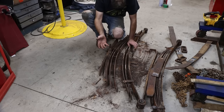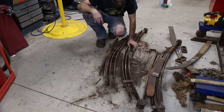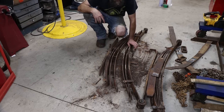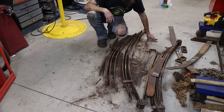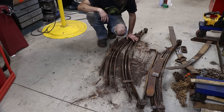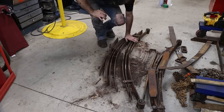You may want to look at your vehicle. I did scan my eyes across these and I noticed they were bad. I just wouldn't feel right getting me, my family, or even other people's families out on the road if something happened and I knew it was a problem but didn't address it. Glad to get this taken care of before it caused any problems. I kept the two top leaves because I'm going to lower the truck a bit - those top leaves would interfere. But I am going to keep them just in case we want to put the truck back exactly the way I found it.